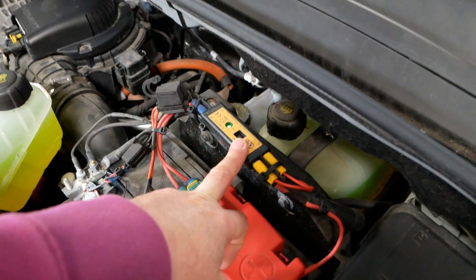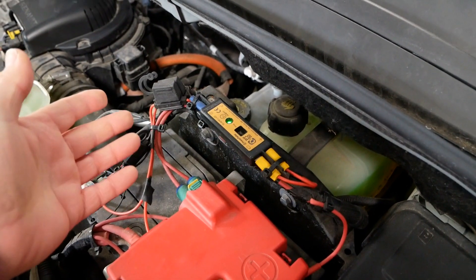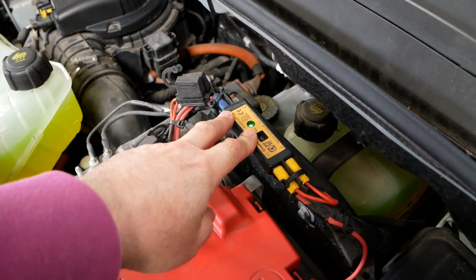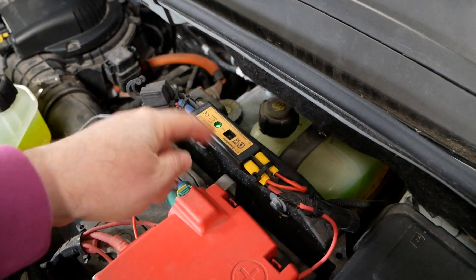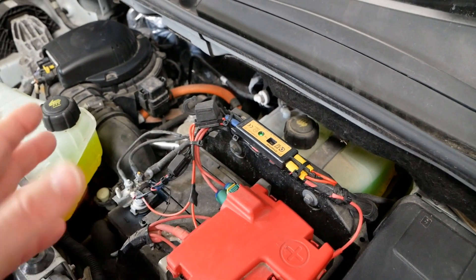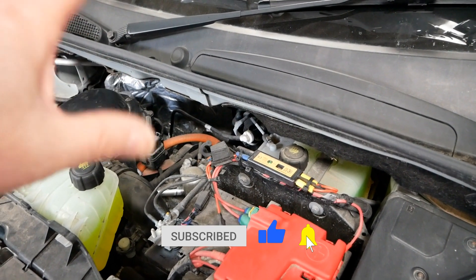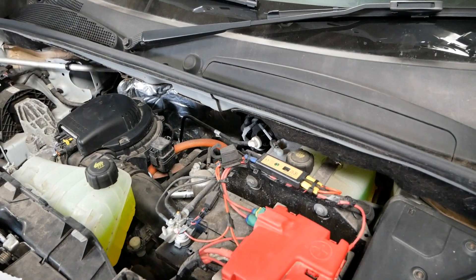I hadn't seen these devices before so I thought I'd share this, because someone today was asking me exactly this question about fitting accessories and as it happens I've got one of these vans in that has this fitted. This is made by Alphatronics — I'll put a link in the video description below so you can find out more. I think they're only about £30, so it's well worth fitting. You just wire your load up one side and your 12 volt battery the other side, and that's going to protect your battery and takes away any risk of running a device with a constant drain. I hope you find that useful, and as always do share and comment. If you haven't already, do subscribe — it helps get the channel noticed on YouTube, more people will see these videos recommended, and more videos coming soon.